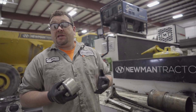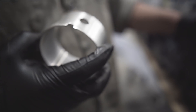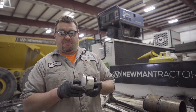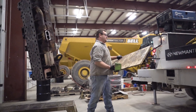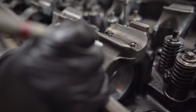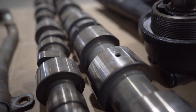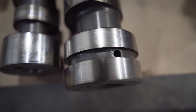We have the pulling tool, but what we didn't have was a die. So I took a new bearing and sent it to my machinist. He cut and designed a die that fits perfectly inside of this bearing, which will enable us to pull and install these bearings. These cams have an oil gallery right through the middle of them, which allows oil to transfer from the head into the cam and out through ports to lubricate the bearings.